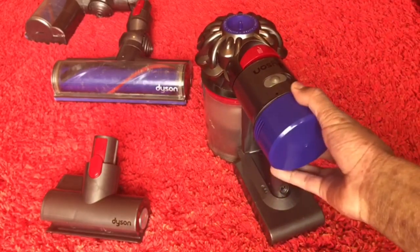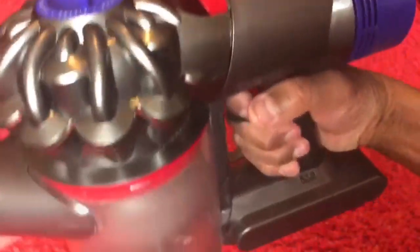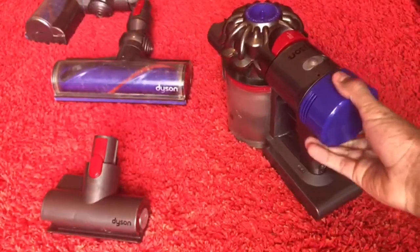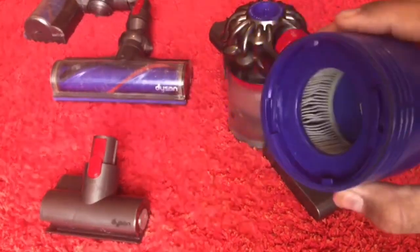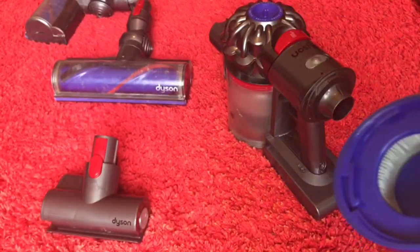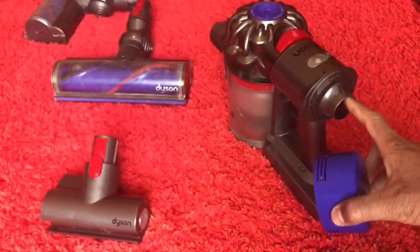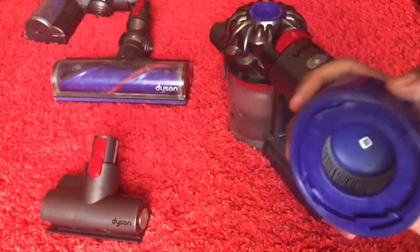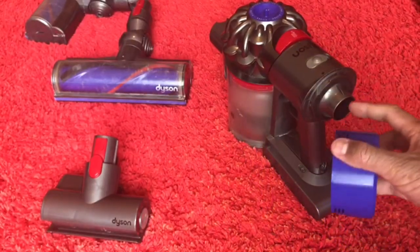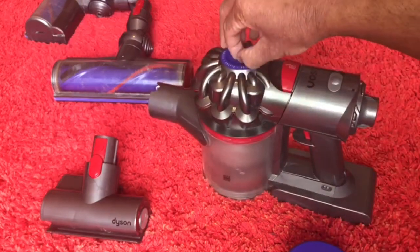People put it back on thinking it's dry but it still makes that noise. Since this is a HEPA filter, the ultra-fine pores get clogged up with water — even though it might be dry, the vacuum can't breathe through this filter because this is where the exhaust comes out. So people think this filter is fine but it's not — this filter is blocked, that's why it's making that pulsing noise. But that might not be the only issue; it could also be the other filter.